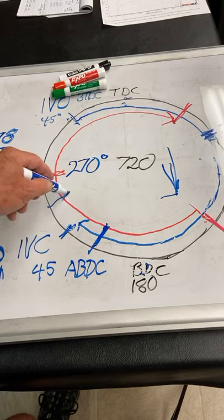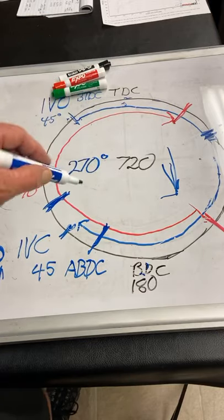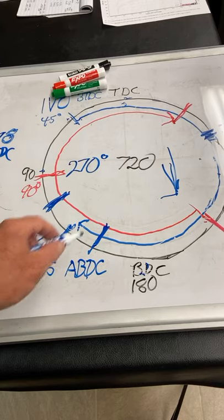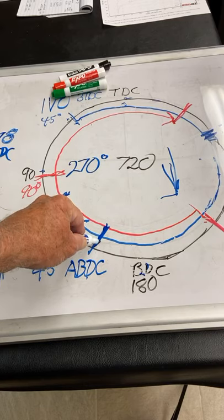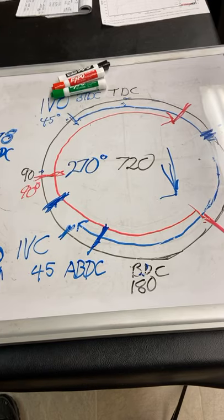And if you've got a real high RPM engine, like a Pro Stock four-cylinder, you might close it way back here so that you're getting, at each speed, this has to change. So now we're seeing Harley and several other companies doing variable timing camshafts. So you can have short duration, early intake closing for low RPM and have a long duration and a later intake closing in order to make more power at high RPM. Exhaust side, same show.